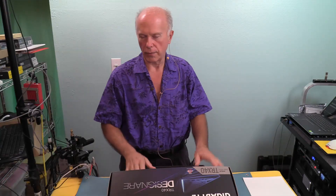Once we inventory this, I want to cut to the chase right now. You've got to build with the minimum amount of components in there, because we need to check this and make sure everything is functioning. Then we add and build up to what we want it to be. If we put everything in and we have problems, we've got to pull stuff out — and that's an absolute no-no. Of all the years of experience we've had building computers, keep it simple. There's a reason for it.